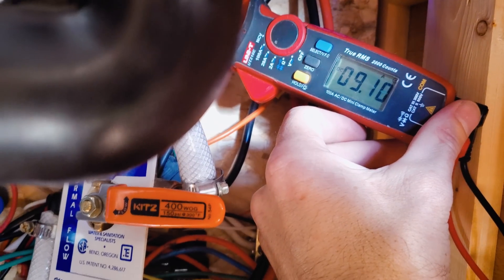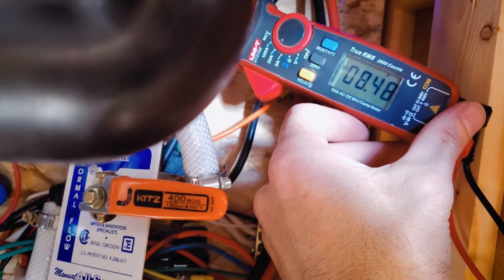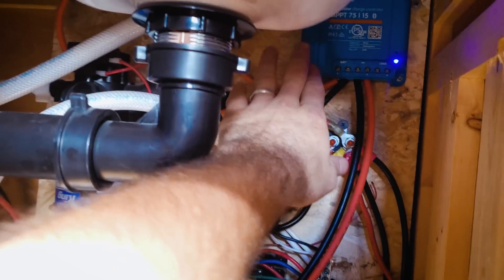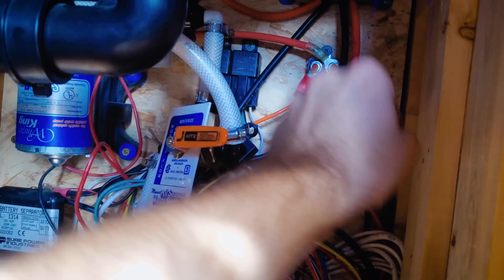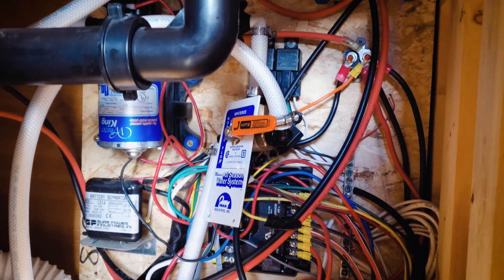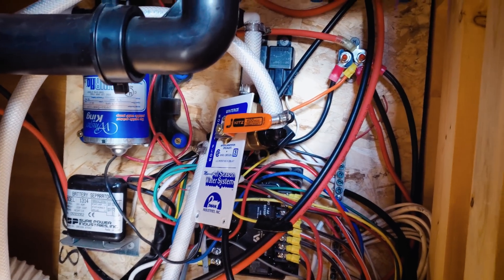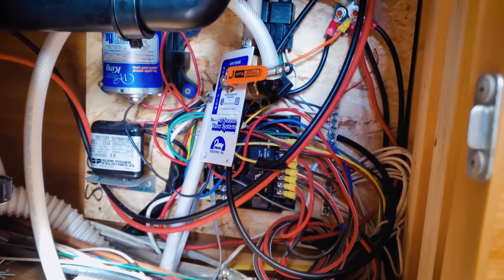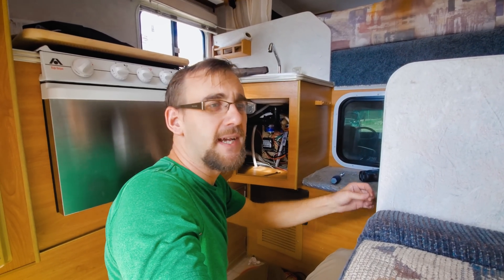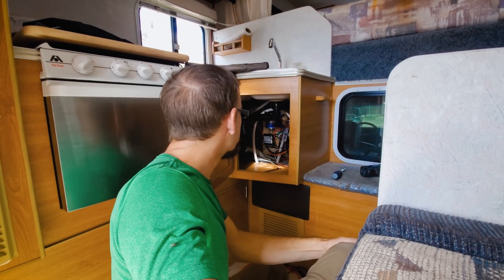We are now charging at a rate of nine amps coming through the wire out of the charger and into the battery. Some people would argue I should not be running my charge wire from the controller into just the common block, but rather take the charge cable and run it straight back to the battery. In this case I don't see much benefit because the gauge wire is about the same and I'd just be drilling extra holes and running extra wire. However, on my bigger RV install I did run solar panel to charge controller, then charge controller straight to the battery bank because it's a much larger system and I wanted as clean a run with as large wires as practical.